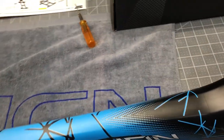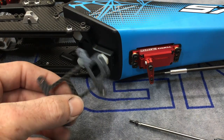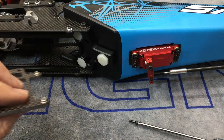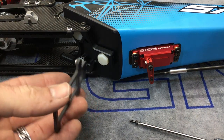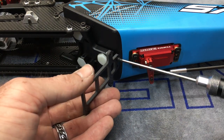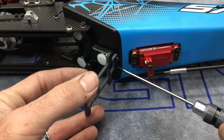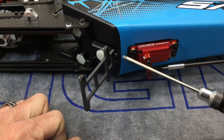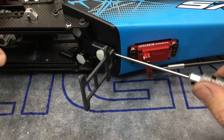Now let's move on to the lower frame side installation. You're going to have this little carbon fiber plate. The manual will tell you to glue these little lock nuts in — mine came glued in, they're tight, you don't need to do that. You'll notice the little plate down here, your lock nuts are going to face towards the front of the helicopter. I already have Loctite on my screws. Run one down, grab the next screw, run it down, tighten them both up. Your lock nuts will be facing the nose of the helicopter towards the inside.